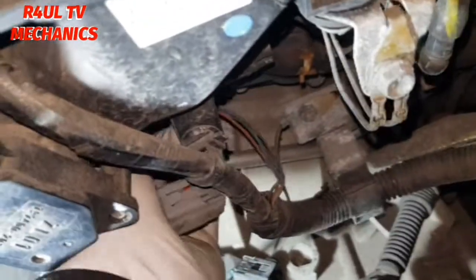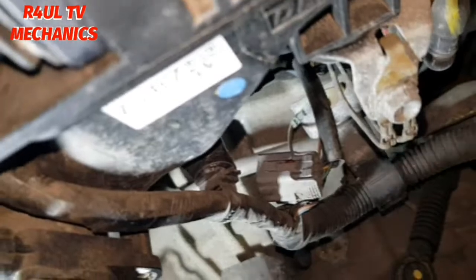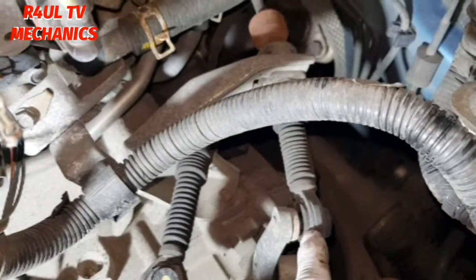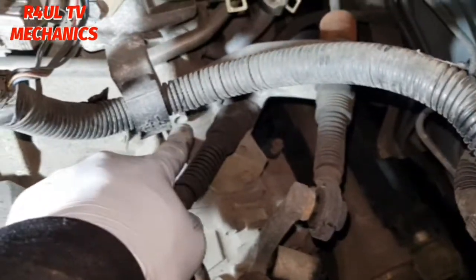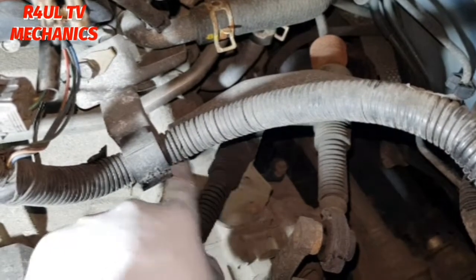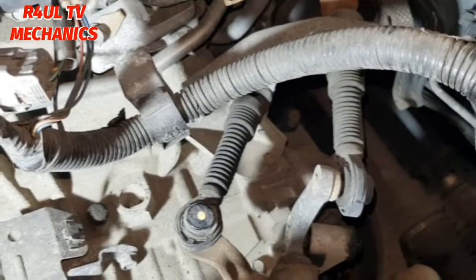Try to do this with one hand. There we go, that's another one. Put that wiring loom out of the way. That can drop down there. Right, so now what we're going to do is we'll put some oil or spray or WD-40, whatever, on these linkages. Let's take the linkages off. We'll take the bracket off from there. One there, another one there. Looks like 12 millis or 13 millis. Take them two off. That linkage bracket should move out of the way. And we'll go from there.